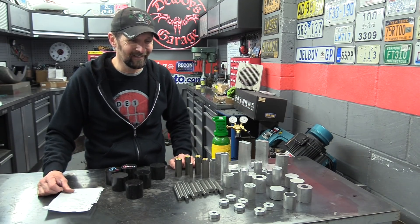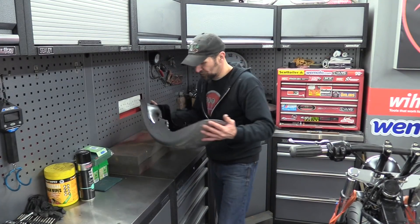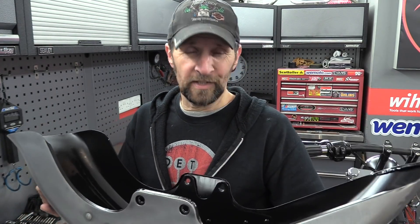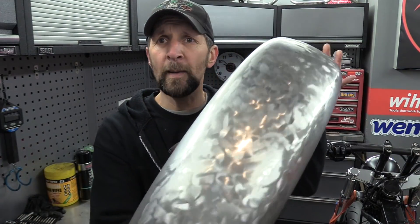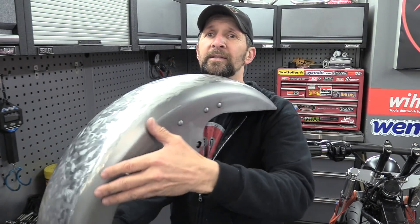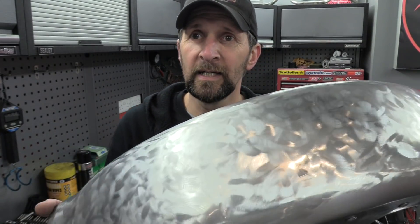Right, let's get on with today's video. Fox Dog Day 26, and the fender has not dried at all — still glossy on the inside because it's so thick. There's two-thirds of a can of paint in there and it's going to take about a week to cure. I put that mottled pattern on with a sanding disc on a little buffer and I think that's a really nice effect. The plan is to keep that exposed paint on the sides in black, put a little pin line between the two, and then clear coat the whole lot. I've seen it done on CVO bikes and it looks really cool.